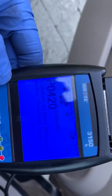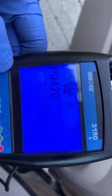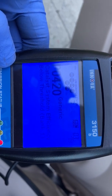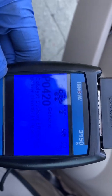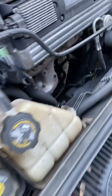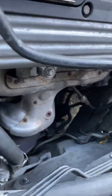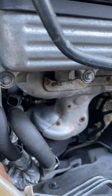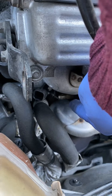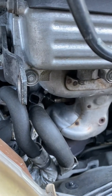Hello guys, Jim here with the Kosh Garage, working on a 2004 Malibu that has a code P0420. Usually those kind of codes yield to be the fault of either the upstream oxygen sensor, which is located right in the middle of the screen right now as I can point out — so it's not hard to reach and get it.